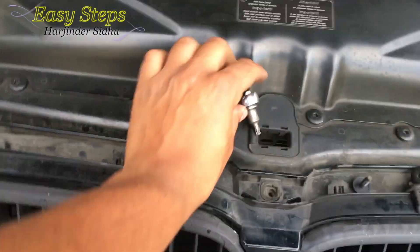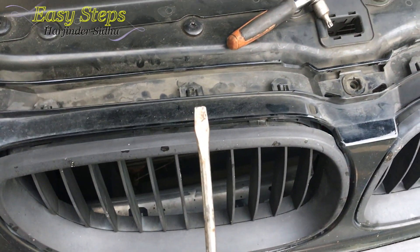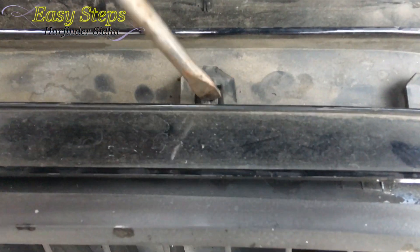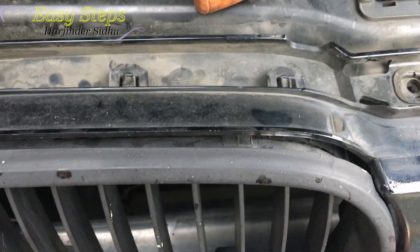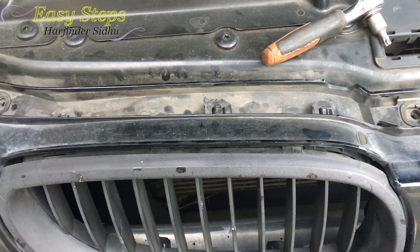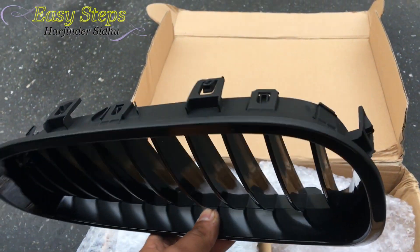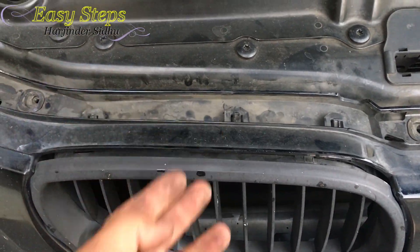Once I've removed all five, as you can see the bumper comes in front. What I'm going to need is a straight flathead screwdriver so I can press this clip down. Once you press it down the clip will get pushed forward and you can pull the grill out. There are going to be clips all the way around — you can use the new grills to get a good view of this.